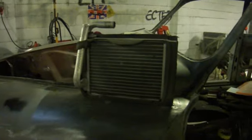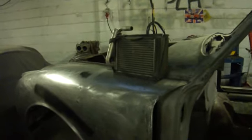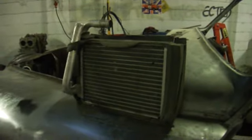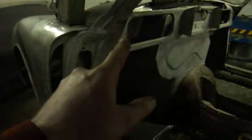I've also used, instead of the standard Jaguar heater matrix, a heater matrix out of a Mondeo — probably about ten years old is the car it came out of. I originally put it in the heater box that was in that black mark too. It actually does go in — you've just got to mess around with the pipes a bit. I've chopped one of them off because it comes originally across there like that, but I chopped them both down. Anyway, that's going in there, so it fits inside the box I've just made, and it'll all go up inside there.